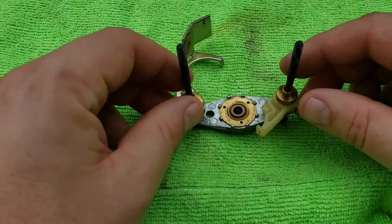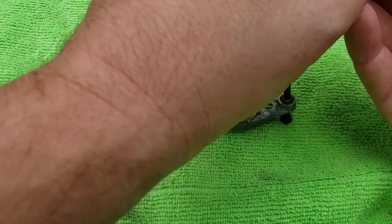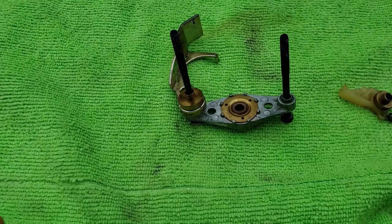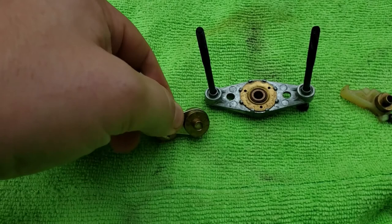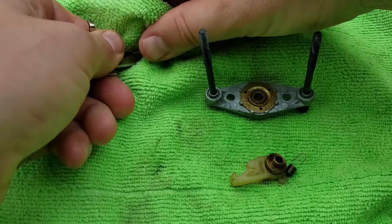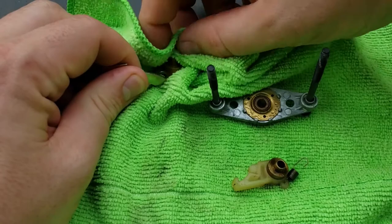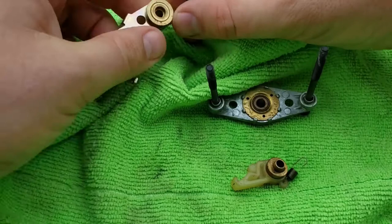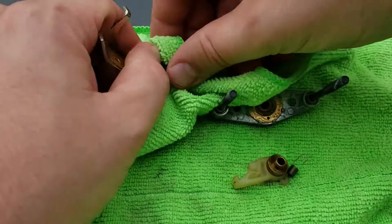Here's the motor brake assembly off the machine on a lint-free rag. There aren't too many pieces — you've got the brake, and a little brass ferrule that it rides on with the spring, which is captured right there so you don't have to worry too much about losing that. On the other side, you've got the weight that pulls the park gear into place. To clean those up, I'm just going to use a little bit of glass cleaner. All the things I've read online suggest glass cleaner only — not to use oil on these parts. It could be because of the nylon, or maybe they don't want it dripping on other parts of the machine. This brass piece is captured, so you just have to clean it by getting the glass cleaner in there and rotating it around really well.